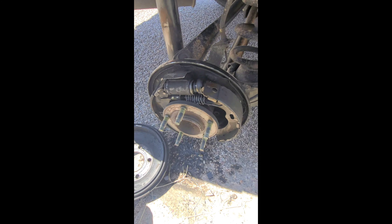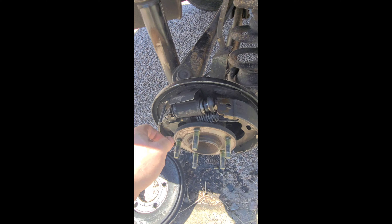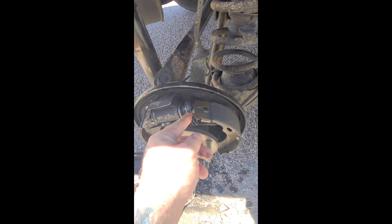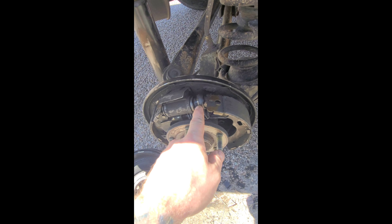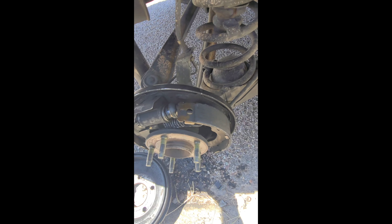As you can see I have it off right here. I had run into some problems taking my wheel hub off. My parking brake was jammed on there so it took a couple screwdrivers and some time to pry it off, but in doing so it left this pretty broken, so when you push the brakes this wheel cylinder will just spray out brake fluid all over the place.